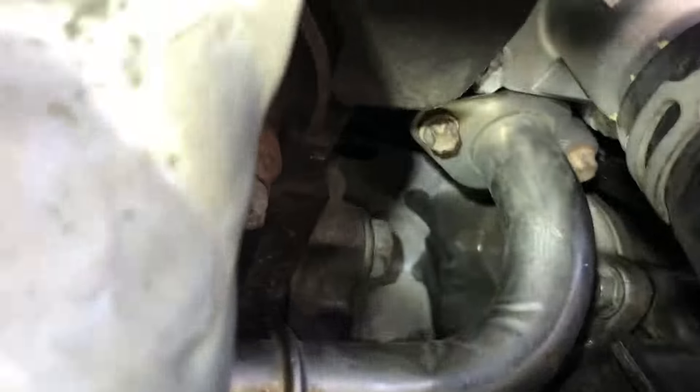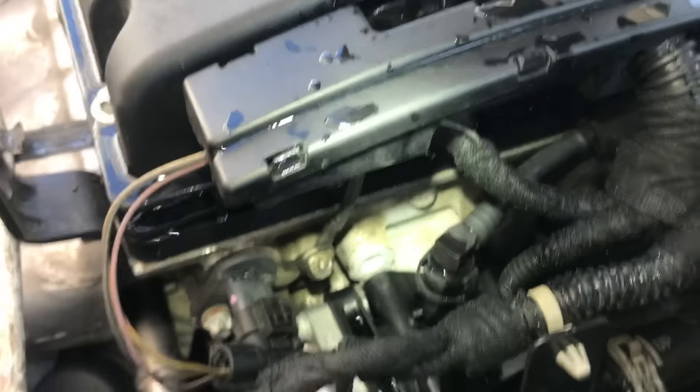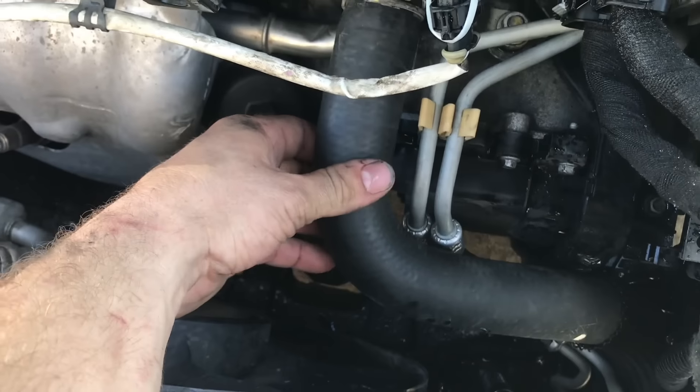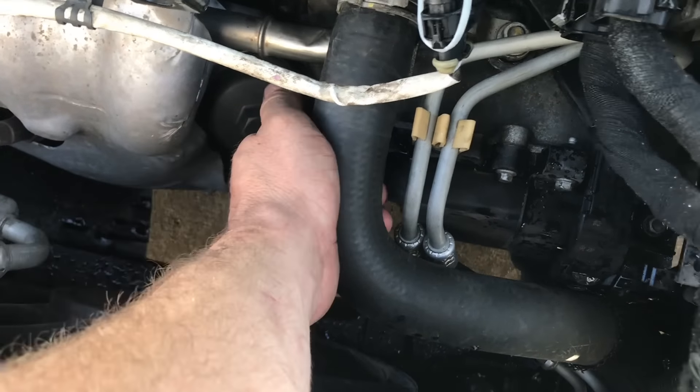After the engine has reached normal operating temperature, check for leaks. Look around all the fittings that we had apart earlier, look around the hoses, and look around the radiator surge tank or coolant reservoir to make sure there are no leaks — look for coolant dripping from hoses and also on the ground from areas you might not be able to see under the hood. Squeeze the upper radiator hose — it should have some pressure on it, indicating the cooling system is pressurized and sealing properly. Check your coolant level and verify the radiator fan is operating normally.